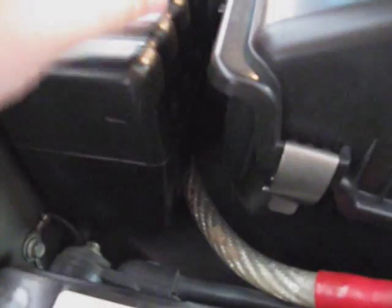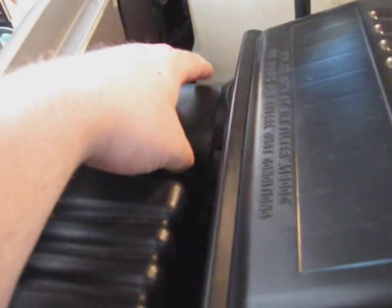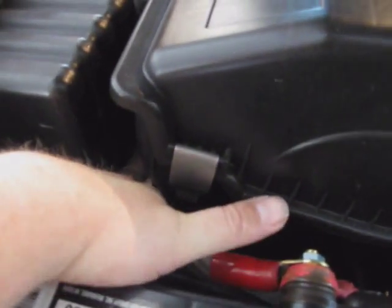As you can see, there's my 0-gauge out of my Suburban. The fuse block is actually mounted to the fender well underneath this box. I couldn't really find a better place — I didn't want to go clear back in the back. I just wanted this cable as short as possible, so it sits right underneath there — it's a nice short cable.